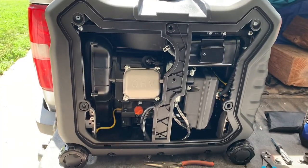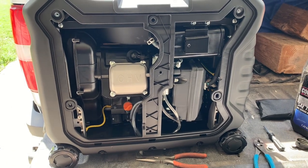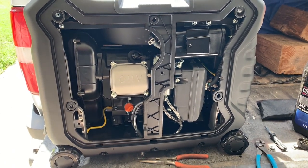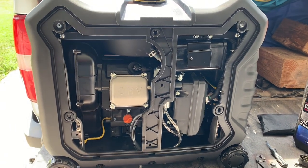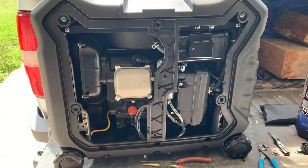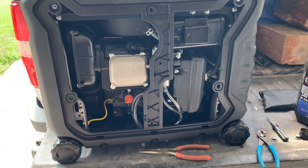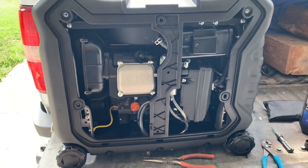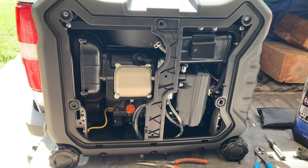I should mention on these that we've tried plugging the valve. We've tried capping the hoses. We've tried leaving the gas cap loose. The only thing that worked correctly was to disconnect those hoses. Drilling holes in the air box isn't going to hurt anything, but it doesn't help your warranty. And certainly plugging those holes doesn't do you any good.